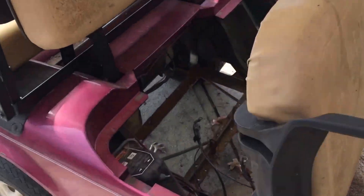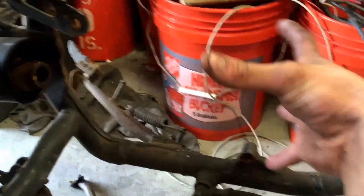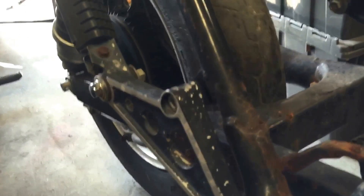What I'm going to be doing is robbing the electric motor out of this Club Car right back here and installing it right about in there. That way the Club Car electric motor is going to spin the drive shaft, and that rear end is already at a 3.5 to 1 ratio, so it should have a decent amount of acceleration and top end.